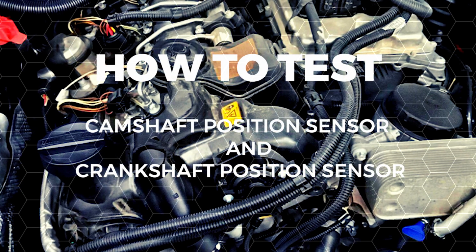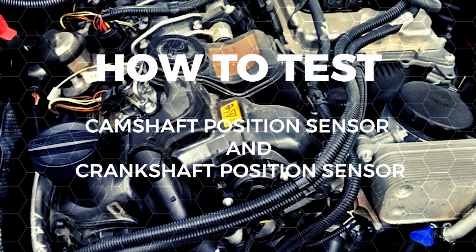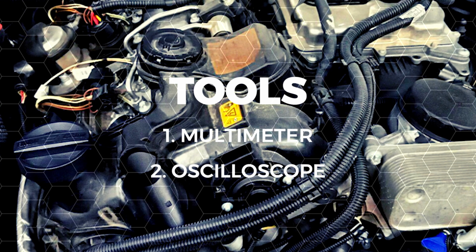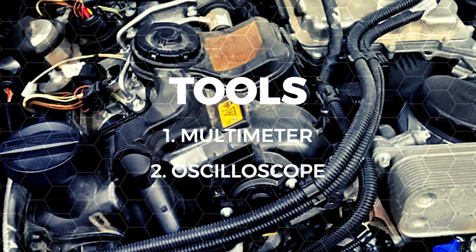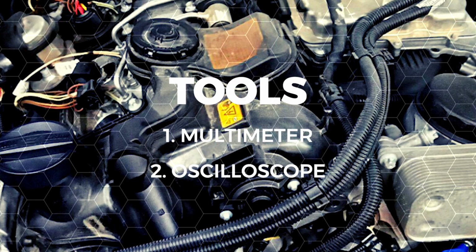Okay, today I'm going to show you guys how to test crankshaft sensors and camshaft sensors on this Mercedes W212. There are two things that you will need to test the two sensors. First would be the multimeter, and second of all, because these are Hall sensors, you will need an oscilloscope.